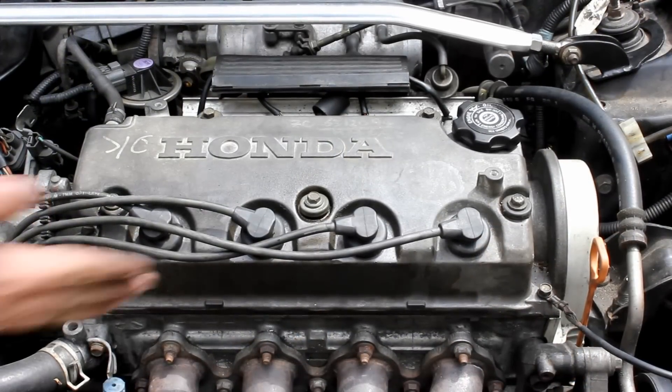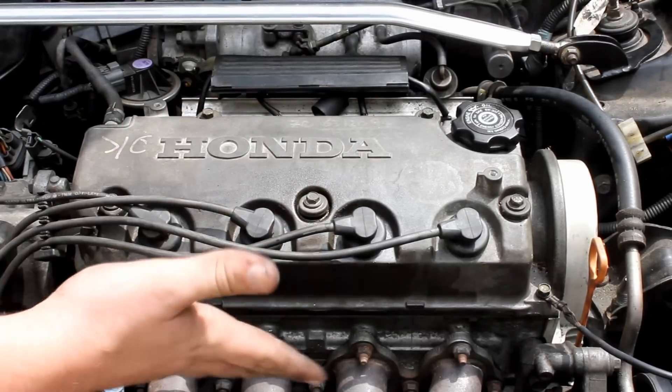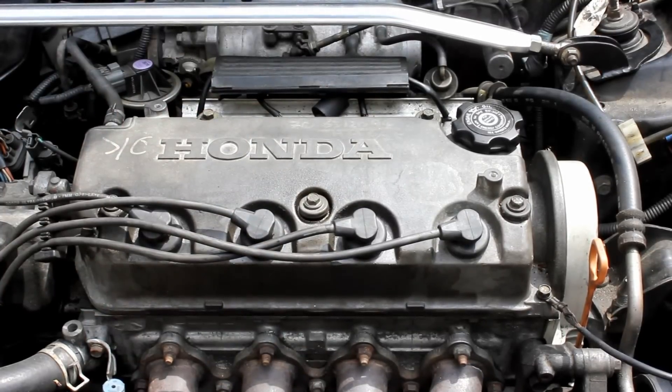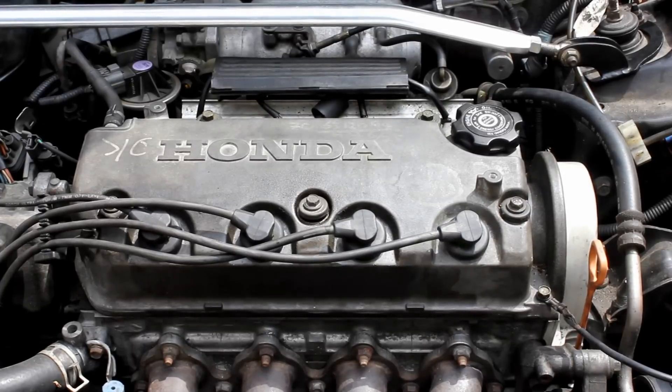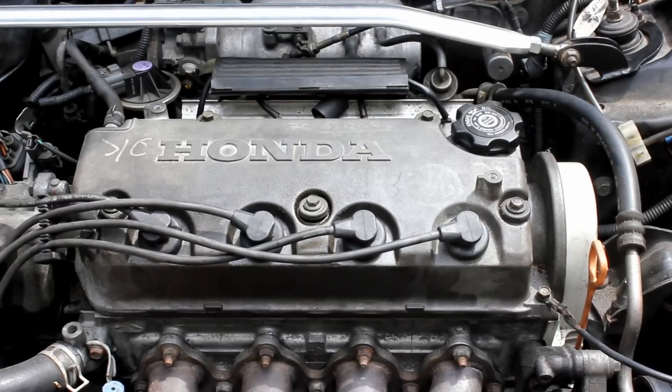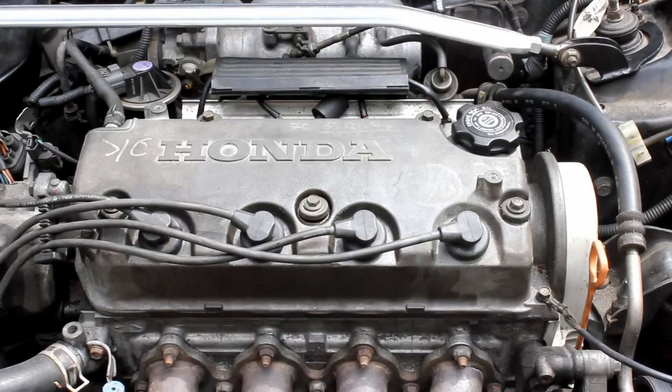Now this is a Honda engine, and on some Honda engines the valve cover will actually say VTEC on it if it's a VTEC engine, but in other cases — like this one — it just says Honda on it and it doesn't tell you whether or not it's VTEC. But this is a VTEC engine. It's not the standard performance VTEC engine — it's the VTEC-E. And there's actually three kinds of VTEC: there's the standard VTEC, the VTEC-E or economy version of VTEC, and then there's also iVTEC, which is the intelligent VTEC. Towards the end of the video I'll give you a description of each of those, but right now I'm going to show you how you can determine whether or not the engine is VTEC.